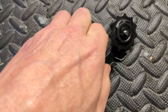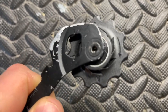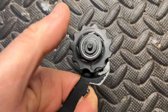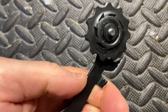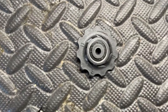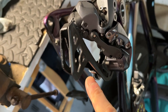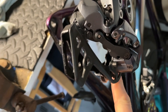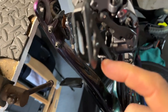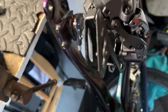So we're going to do the A first. I've pre-installed it onto the cage — we've just got the bolt, the wheel through the cage. Then we're just going to screw this in and put in the B one from the other side, making sure it is orientated properly. The A one is in down here. We're just going to slide the B one through there and then put the bolt in and do it up. Make sure they're both tight. Put the chain on.